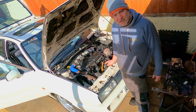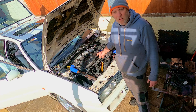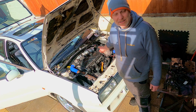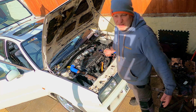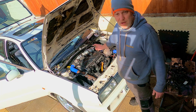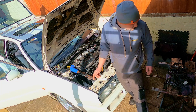Of course you're always going to get an over-fueling event, so your miles per gallon will actually go down when you block it off if it's not really well mapped. You've got to be able to equate for it — on idle it's using twice as much air as expected, so for argument's sake it's putting in twice as much fuel on idle. So why would you do that?